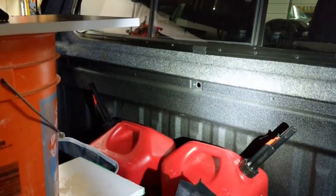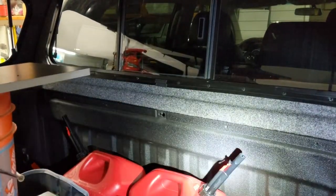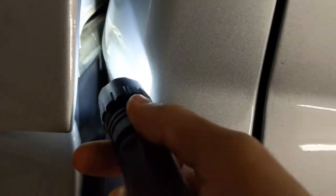I looked and was like, why is it leaking? It's basically coming up underneath from the front. When they put this on, this part is supposed to come down over the front here, but it was tucked up underneath. So when water was hitting on that ledge, it was just pooling up and running under there. This flange is supposed to go on the outside of the bed all the way around, so when water hits it, it just runs down off.